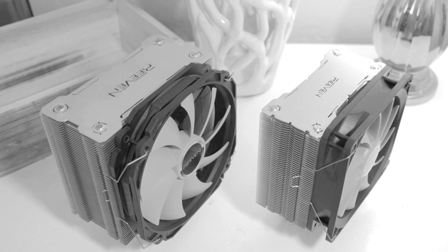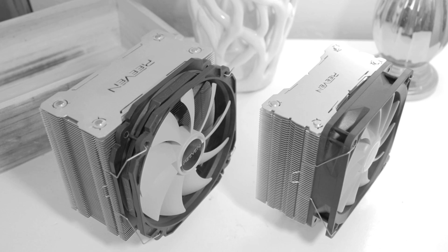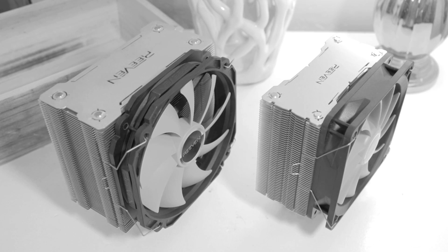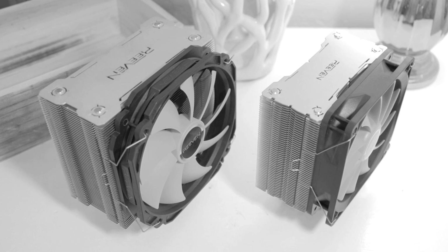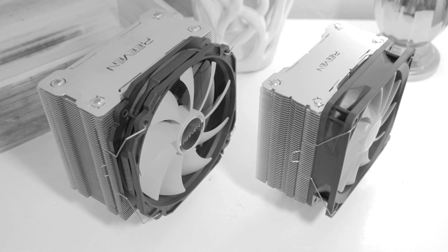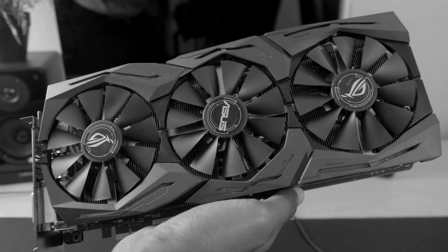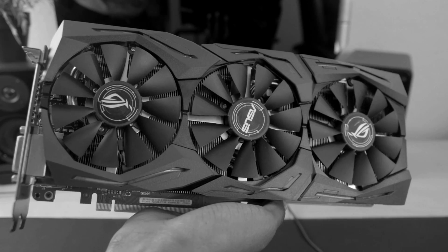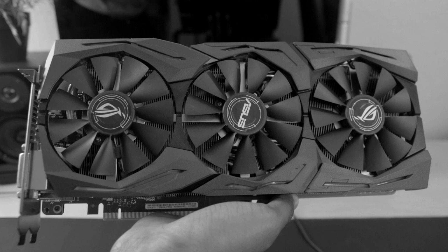As for CPU and GPU clearance, you've got up to 170mm of space for your CPU cooler, which should allow you to run some beefy tower coolers. Even the typical Hyper 212 Evo or CryoRig H7 will fit easily in this case. GPU clearance is up to 395mm without the optional hard drive brackets installed, which means you can run pretty much any graphics card on the market today.